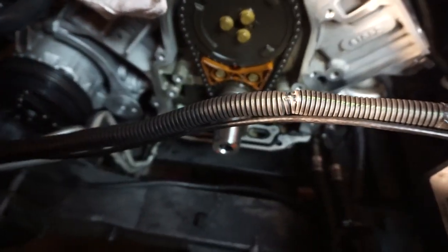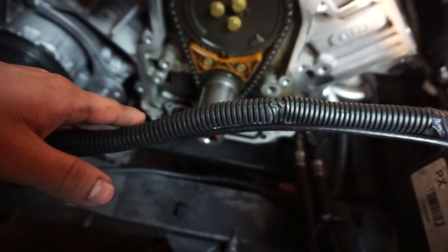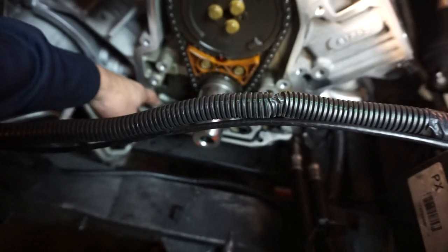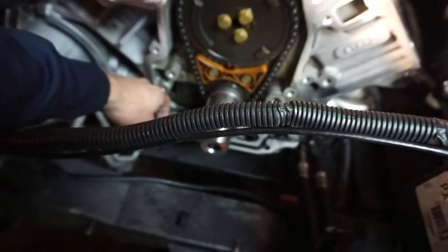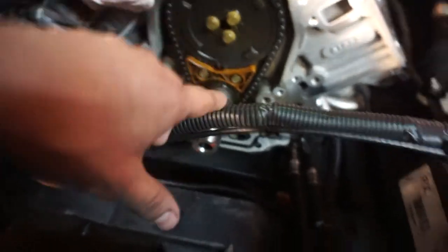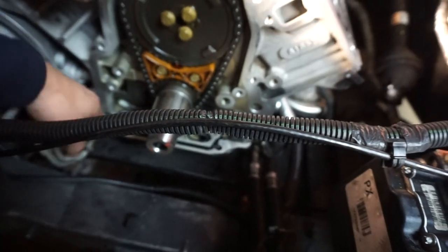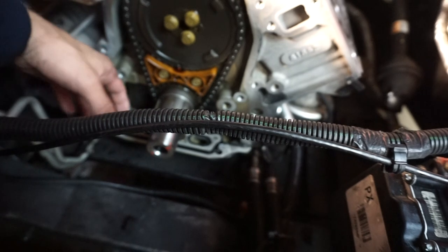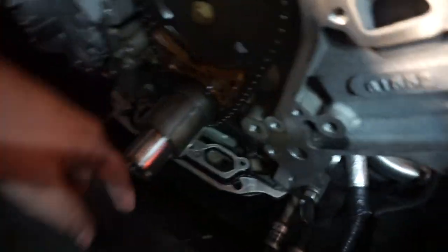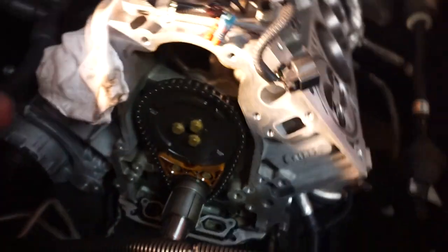I tried to take off the oil pump by just wiggling it, however the O-rings for the oil pump are part of the oil pan gasket, so if you damage these that means removing the cradle and lifting the motor. I really didn't want to do that, so I ended up loosening all the oil pan bolts around the motor, and then it gave me a little bit of clearance to drop the pan down a little bit. Once I did that I was able to walk off the oil pump. There she is, nice and pretty, and of course all our O-rings — very crucial — are intact and looking good, so we can go ahead and reuse that gasket.